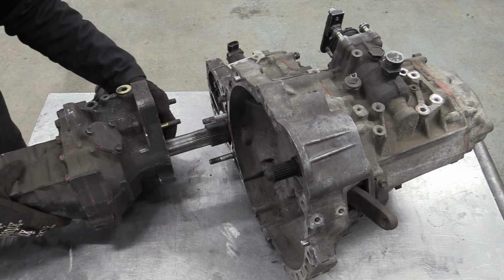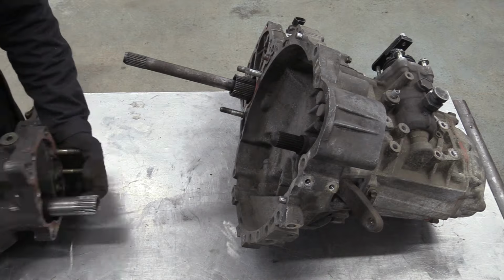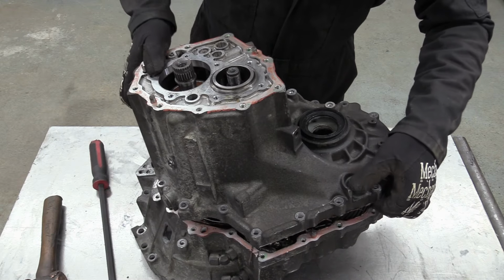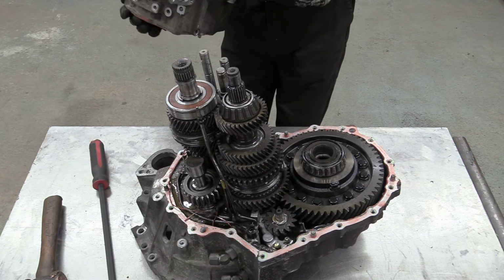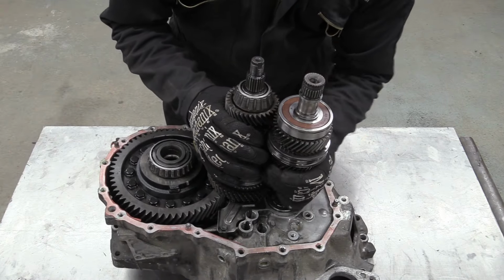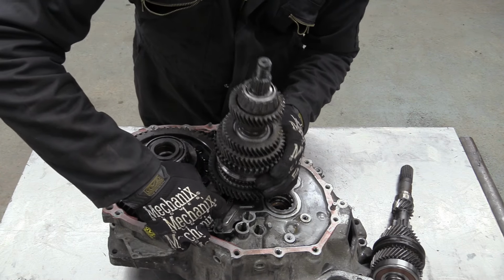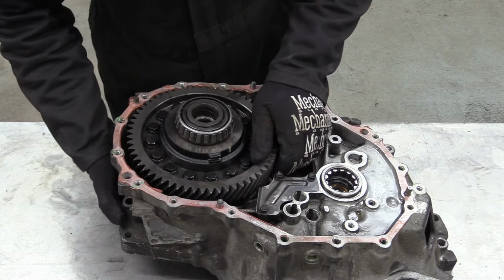First thing to come off is the transfer box. Nice catch. Then the gearbox end case is removed. After whipping off fifth selector and gears, the main case is unbolted and split in half to reveal the gear cluster and the front diff. After fiddling with the oil pipes and selector rods and various other mechanisms, the main gear clusters can be pulled out. Followed by the diff.